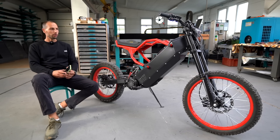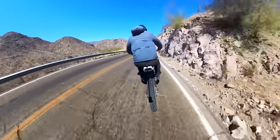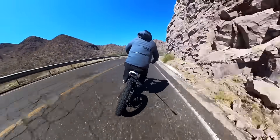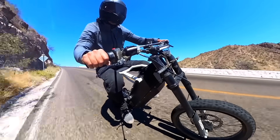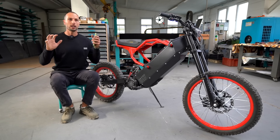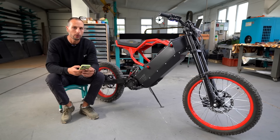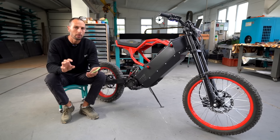At the beginning we only had a maximum speed of around 100 kilometers an hour — 60 miles an hour. It does run faster but it's kind of an overdrive that you can only do for about a 20-second burst to 130 kilometers an hour. Since we received the first batch of a just-one-tooth-bigger front sprocket, the bike is a game changer. The power now shifts from low speeds all the way to 120 kilometers an hour. In high speed at 100 km/h you still twist the throttle and it shoots you out. Now it's a comfortable 120 kilometers an hour — 75 miles an hour — continuously, and it can still boost you faster but only for a short period of time.